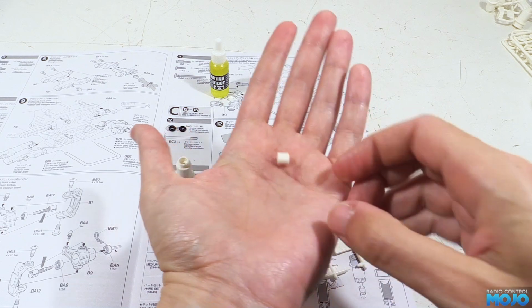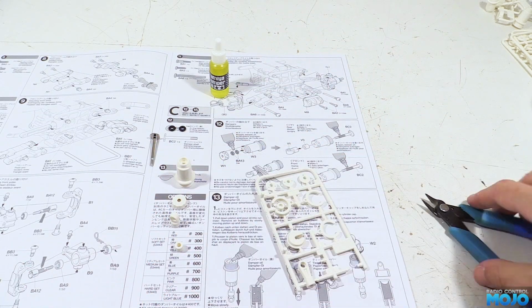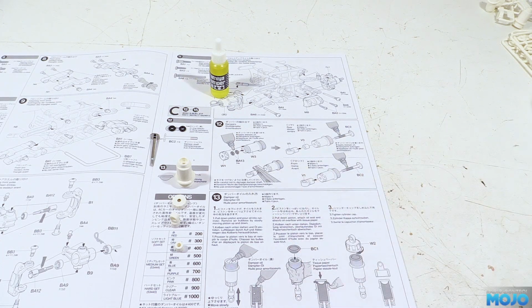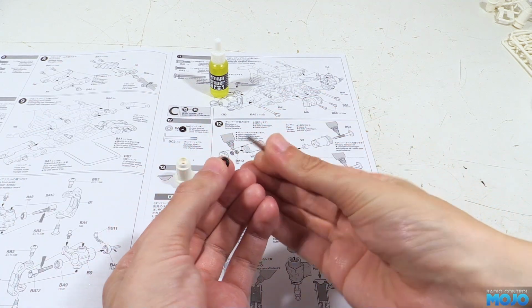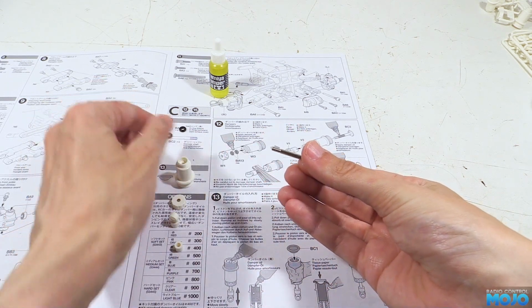If you follow the manual, you're going to end up with some working dampers, but there's another method that helps protect the O-ring during assembly. Rather than pack the bottom of the body with the O-rings and fit the bottom cap, then push the thread on the shaft through, we'll assemble the O-rings onto the shaft before pressing them in.